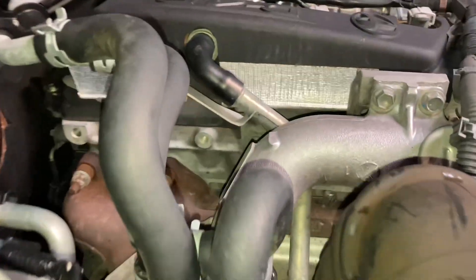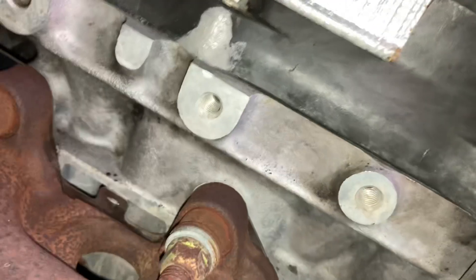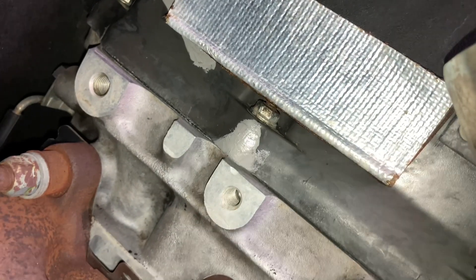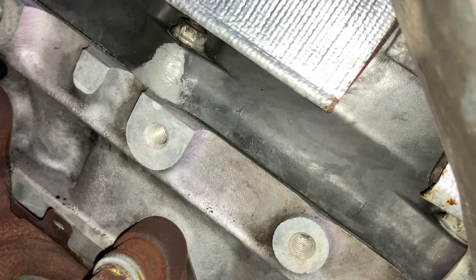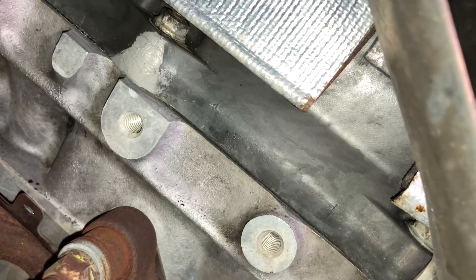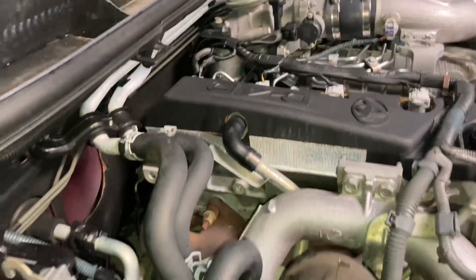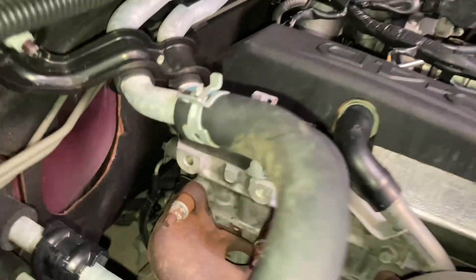Starting up here at the top — you might remember the valve cover, the crack at the side there. Mainly the RTV on the inside and a little dob there. That is permanent, that'll last forever, and you can see there's no oil, there's no sweat, there's no leak. And we've also done the RTV trick behind there underneath the valve cover. You wouldn't normally really see or even notice that, but that saved $400. Bone dry up the top. We also put the bolt in at the back for that vacuum line as well.